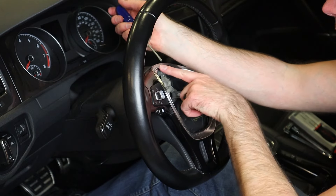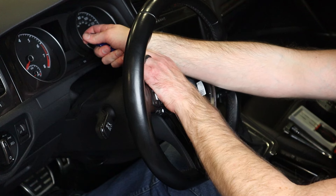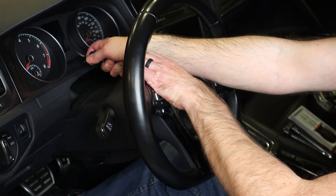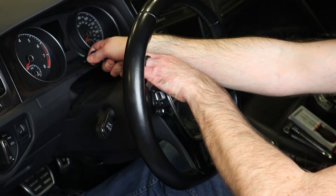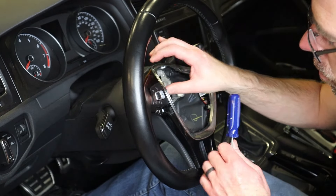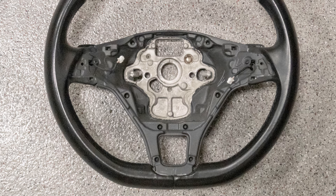I got this part to release. What I did was stick this screwdriver on the edge here on this lip, then I put my fingers underneath and pushed with this while I pulled with this hand — and that helped it release. That's really what you need: constant pressure in multiple areas while you're pulling at the points where it clips. Once we get this trim off, I can show you where the clip points are to give you a better idea of exactly where you should be prying.